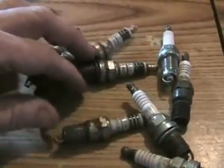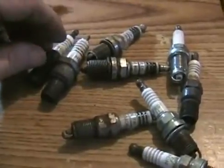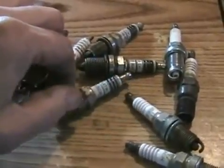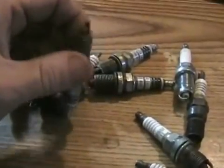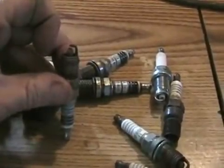For your car spark plugs, since they have a liquid-cooled motor and work under pretty similar conditions every day — summer or winter — and you're usually not racing or anything, I wouldn't recommend changing the type of spark plug you put in your car, other than just improving it to a platinum or a multi-tip one for long life or a little bit better performance.